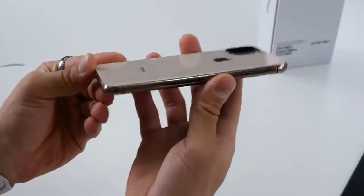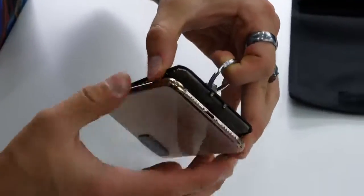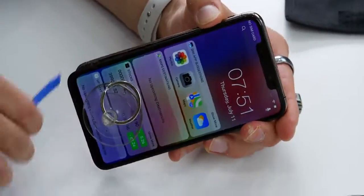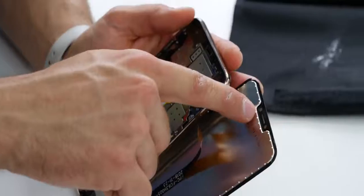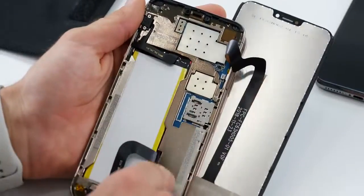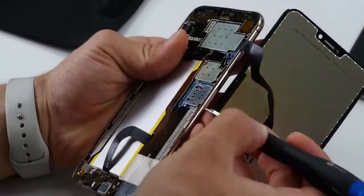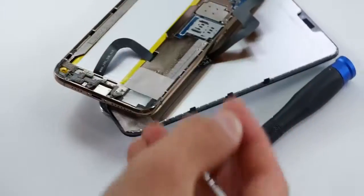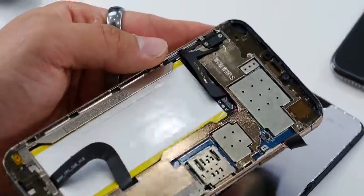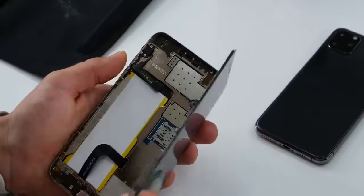Let's take a look inside and hopefully not crack it because this seems like real glass. That came out ridiculously easy. Don't do this to your iPhone clone without turning it off. The plastic surround just broke off. As you can see, the LCD was carved around the notch — it's genuinely a real notch — and a very tiny 2 megapixel shooter. All of this over here is heavy metal to give it the weight; without this it would have felt very cheap. This does have dual SIM. They actually copied Apple's dual SIM layout — the SIM card tray has the same stacked dual SIM. This is actually the first iPhone clone that opens the same way the iPhone does; most of them open from the back.